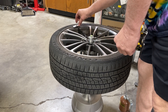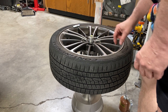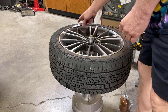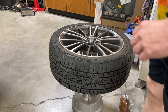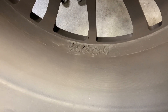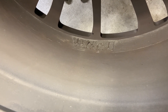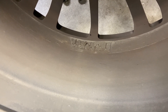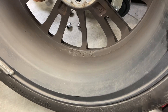It looks like if we put one ounce right about where the other ones appear to have come off, we have a pretty good balance — in fact it looks pretty much dead center. We'll prep that surface and add these weights, then check it once more. There's a little bit of adhesive here that we need to pull off if we want the new wheel weights to stick well. Pulling that off could potentially change the balance slightly, so once it's cleaned up I'll put the wheel back on the balancer and check the balance one more time before adding the weights.